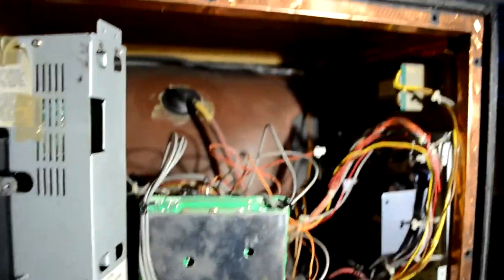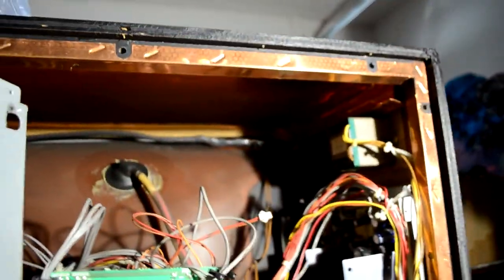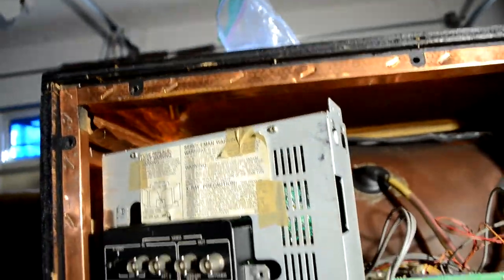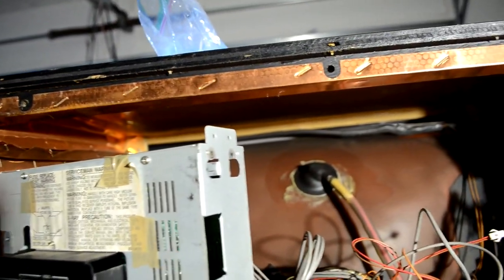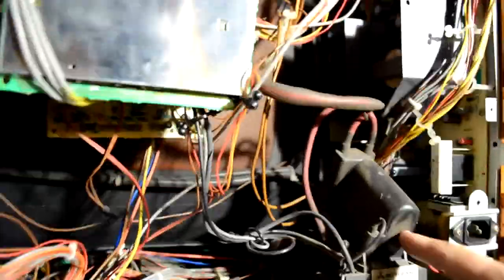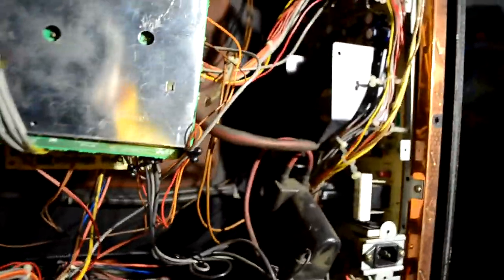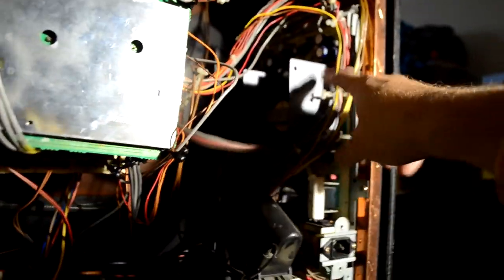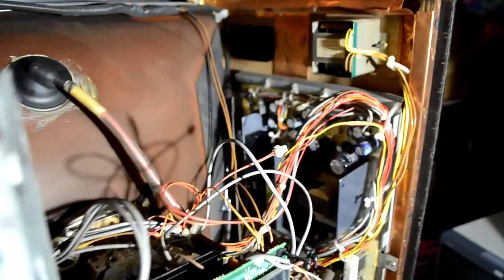Here's the inside of the monitor. It's a very interesting design — it's completely lined inside with copper, presumably to limit interference. You can see how that's tacked up around the top and the sides and goes all through the inside. Then there's the tube and our flyback anode right there. It's a very interesting flyback that Mitsubishi has here — it's like a double flyback almost. And there's our power in. Over here is our power supply board, and that must have some type of an issue because we're not getting clean power into it.